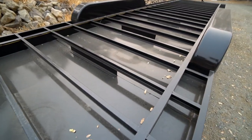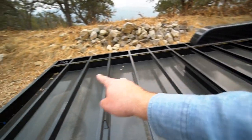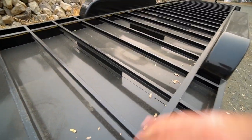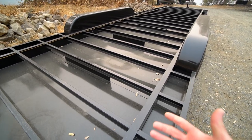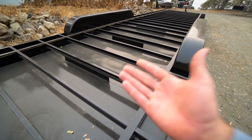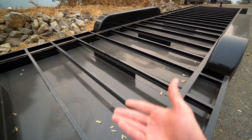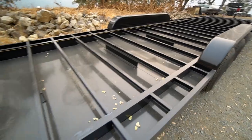And on the flashing, we intentionally do not seal all around it. That is because if you do get water inside the belly, it allows a place for the water to come out. So whether you are getting flashing on the trailer at the factory and we include it, or you're putting it on yourself, we always recommend leaving some area for water to come out if it does leak from your house and into the subfloor.